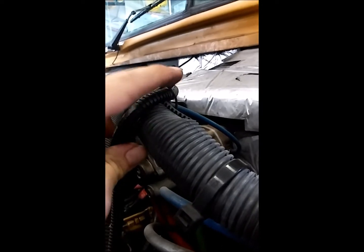It leaves quite a bit exposed off of the ratchet area, and when you cut them with a pair of dykes it sharpens the tip. These zip ties are on everything, so as you're working on an engine or wiring, it's gonna leave sharp wire ties everywhere. That's why you want to cut them the right way.